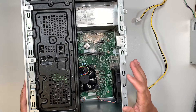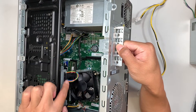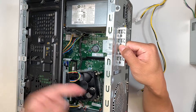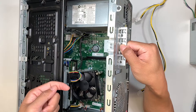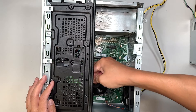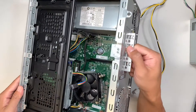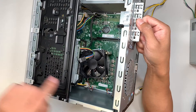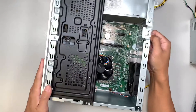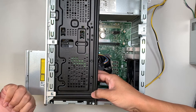You get to see the entire computer. The next step is to disconnect the DVD/CD-ROM cable — this is the power and the SATA cable. There's no clip or anything; all you have to do is pull it away from the DVD drive, pulling to your right. Pull the SATA cable and the power cable straight out. Then push in the black release lever and slide the DVD drive out to the left.